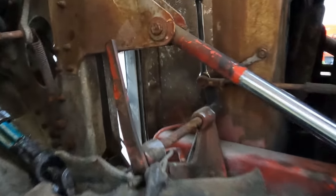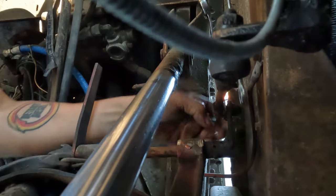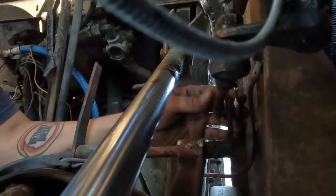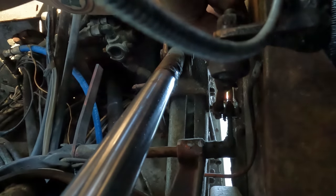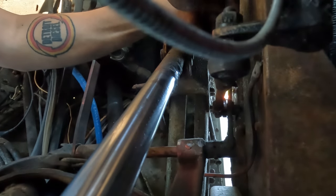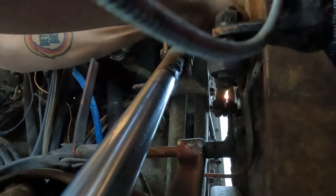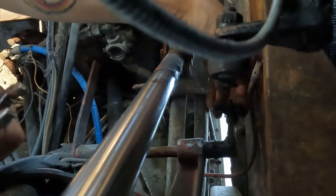I've got to unstick the throttle, first of all. Yeah, see, it's buried here. Make a little modification to this throttle linkage. The issue I'm having is it needs to be bent, in my opinion. So, this lever right here, where the wrench is, I believe that needs to be bent towards the radiator a little bit. So we're gonna bend it. Oh boy, that was tight. But I don't really wanna do it with this linkage on there. I'm not sure how I'm gonna bend it yet.